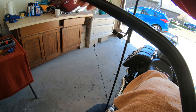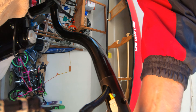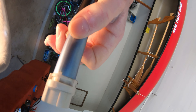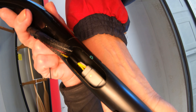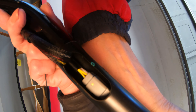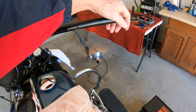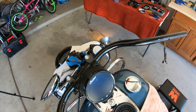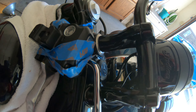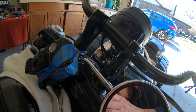The next thing we've got to deal with is this — it's plugged in and I think it's inside there. The next thing we have to do is disconnect the throttle. There's a wire inside the handle and a little pin down there, and we have to push in on the little orange spot there and disconnect it. We got the throttle cable disconnected. Now we have three more connections in here — we're gonna pull those through and see if we can get them out of the bars.